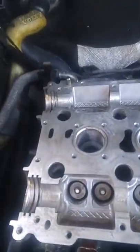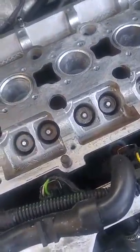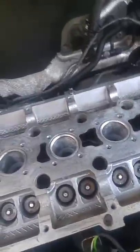We're working on the Volvo XC90, 2003 year. We went ahead and pulled out our cams and the timing belt today. We had a little noise here on the upper end, so we checked out all these bearings. We had a clogged oil feed galley that was leading up to the head.